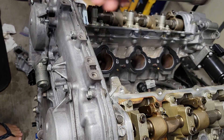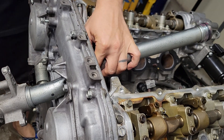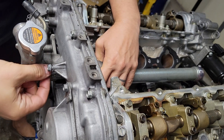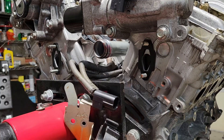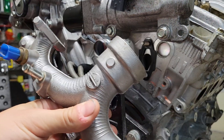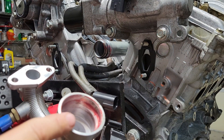We got the knock sensors in. We want to put our cooler crossover pipe in next. Put a little lube on that before you stick it in. We'll put all three of these bolts in a little bit loose. Now you can see your coolant pipe, the harness for the knock sensors, and our back coolant piping. There are two o-ring fitments on this. That main pipe goes in there — leave that o-ring and this one pretty good too.